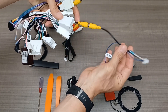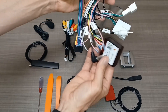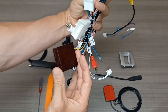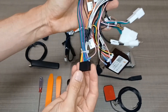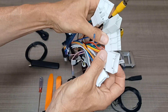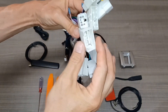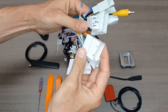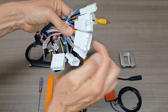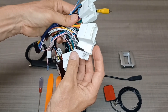Then you've got your all-important main harness, which already has the video-in pre-attached for your backup camera, and the canbus for your steering wheel controls already plugged in. The main harness connection has various connectors that go into your truck. Just be advised some of these will not be used — you always want to start from the truck and work backwards into your harness.